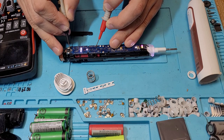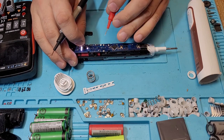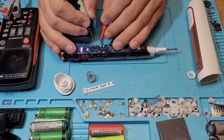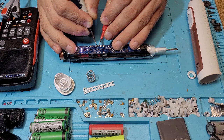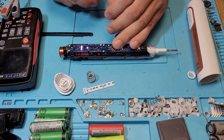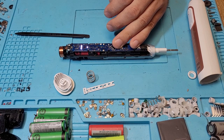After the fuse we have a much smaller voltage, and that was what I found in the other toothbrush. If you change to resistance measurement, the fuse was not completely dead, but it had already increased its resistance. At first I hadn't checked the fuse and was starting to suspect MOSFETs, transistors, and everything around it. But in the end the fix was much easier.